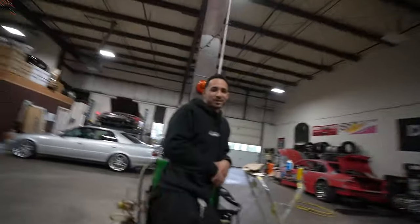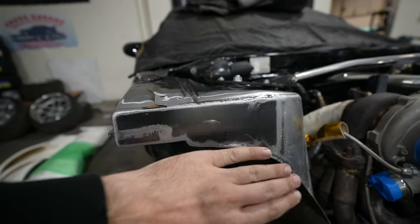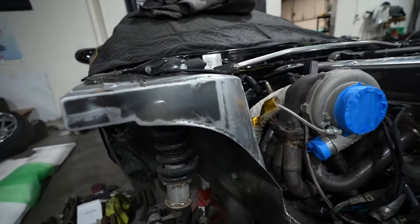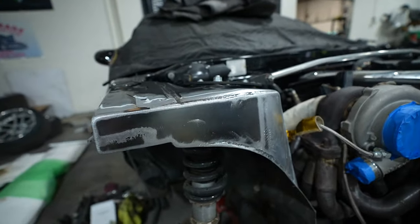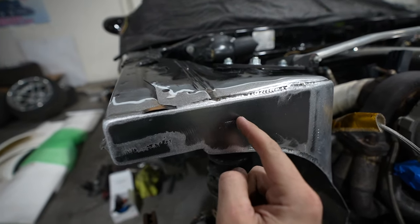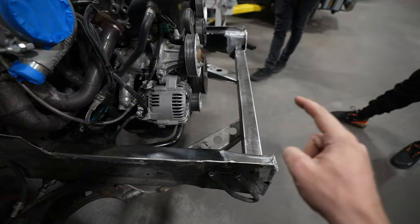Ruddy's having some injector issues so I sent him to get them cleaned, but perfect timing because Spoon just finished welding and this is sick. Check this thing out — look how beautiful these things are. It's perfect. Now we have a really strong foundation to build off of because we have a thick piece of metal dispersing the load all through the tower. Versus if we just welded a tube straight to the tower, it's only that thin piece of steel it would be attaching to. No bueno.